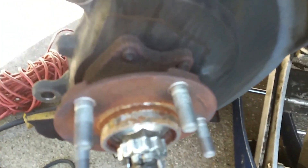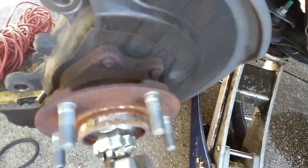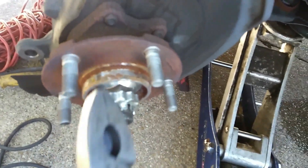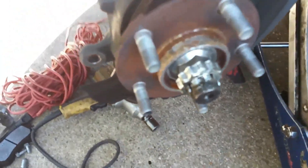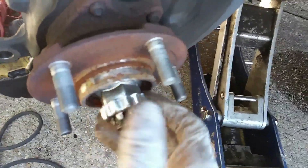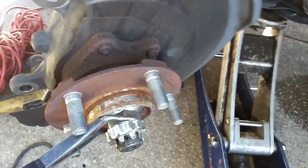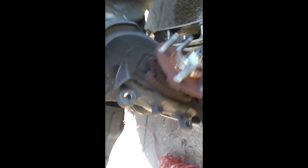This is the axle lock pin. You need a pair of pliers to bend the pin straight in order to get it removed from the axle — just straighten it and pull it right out or knock it out, whichever works. Then that bolt retainer — get that off of there. That's a safety mechanism to keep the bolt from going loose. These axles handle a lot of torque and vibration, so whatever it takes to keep them tight. A loose axle bolt can also cause a bearing to go bad.